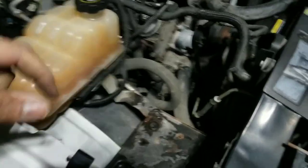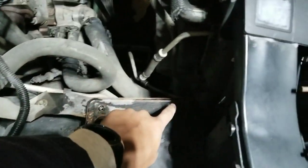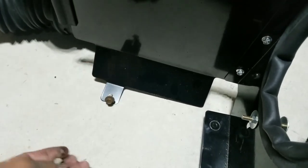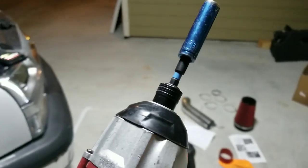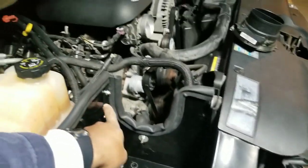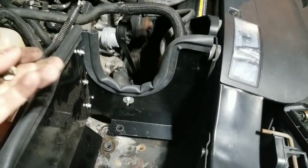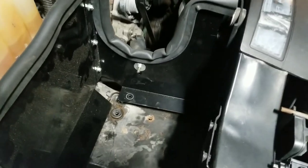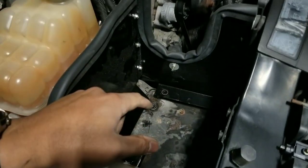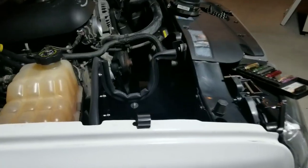Before you go to install your box, you're going to want to remove three screws — one here, one on the front corner, and one right here. They look like this and they fit down through these three holes on your new box. They are 10mm bolts, so you want to remove those first. Then grab your box and go ahead and try to situate it. When you put it in, make sure these bolts are loose so you have room to move it around, because it's not going to line up perfectly when you first put it in. Make sure the bolts are loose so you can wiggle it around and fit it how you want.